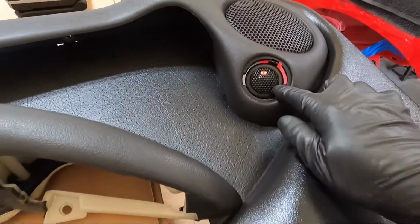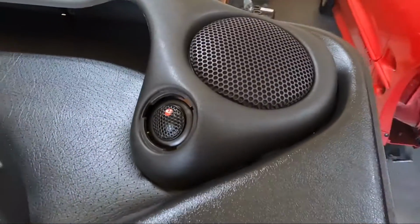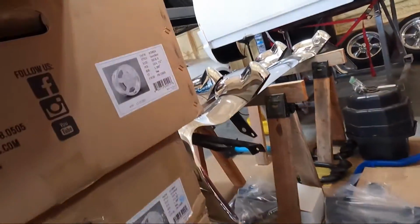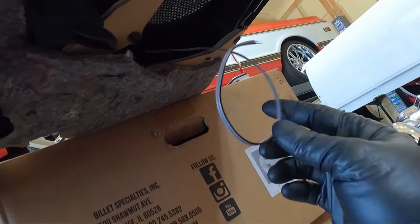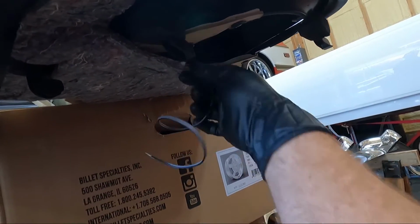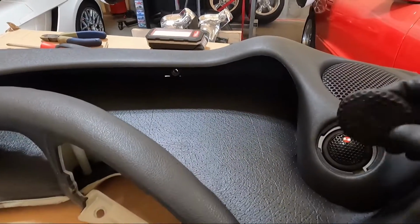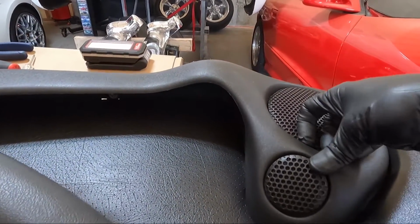Check it out. He threaded it through while I was pushing. Got that through there. It was a little snug, obviously, where the heat shrink was. But now we've got it into place, and I'm feeling good about this, guys. So now we can solder our connection on for the original Monsoon stuff, and we will be good with the tweeter. He's got the cover here, the closeout. Go ahead and put that sucker back on because we are done right here.